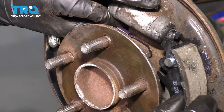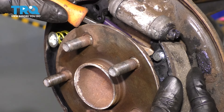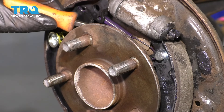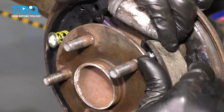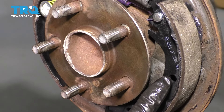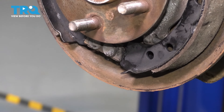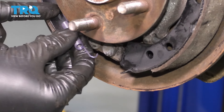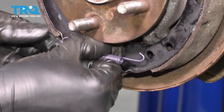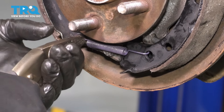The spring needs to attach into this hole — bring the shoe in enough to hook it, bring the spring around and hook it on. Then pull the shoe, slide it into the wheel cylinder, and compress it. Wait to attach the retainer until the other springs are in, since you'll need to move the shoe around. Reattach the bottom spring now — that's the symmetrical spring with 180-degree hooks on both ends that attach into the lowermost holes. Use locking pliers to pull it into position.